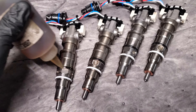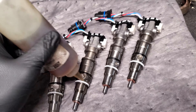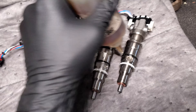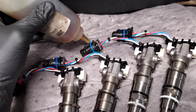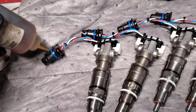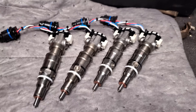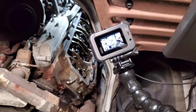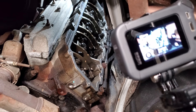What we're going to do — you've seen me use this before — we're just going to go ahead and lube up all of our seals on our injectors. Make sure when you remove the old injectors that the copper gasket came off with the injector and it's not stuck down in the bore. Additionally, I like to apply a thin cord of oil to the blue rubber O-ring that goes through the rocker box gasket so I don't have to fight with those. First time using the GoPro to illustrate this, but hopefully you guys will get the gist of it.